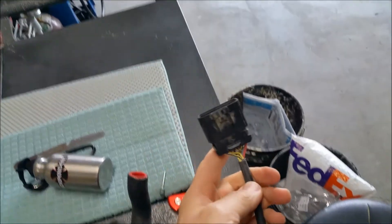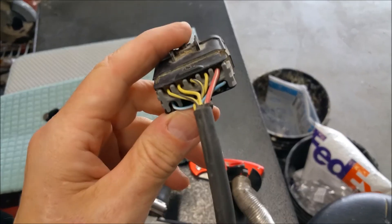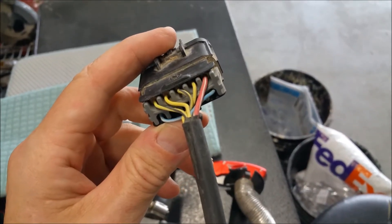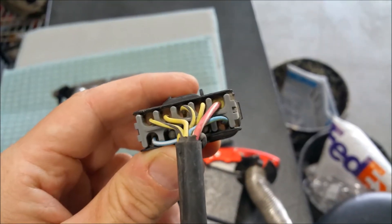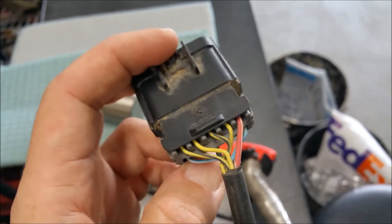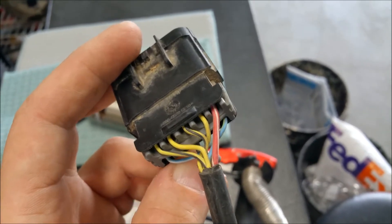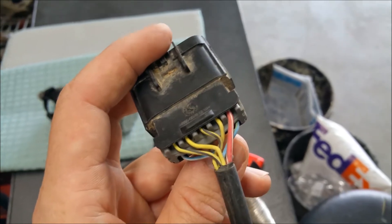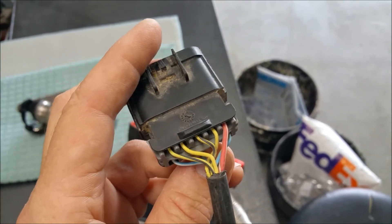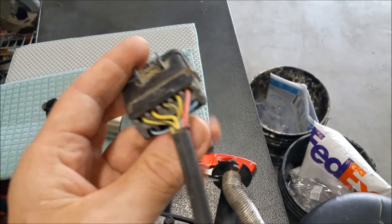GM, in their infinite wisdom, since they don't like people working on their own vehicles — see the yellow wires there, the yellow with the black stripe and the other two yellows — those are CAN bus signals. If the ECU in this heater doesn't receive the correct CAN bus signals, it will never turn on. You could use Arduino and program CAN bus yourself, but you have to make sure the parameters sent to the heater are less than 39 degrees Fahrenheit ambient temperature and your altitude is less than 4,500 feet.